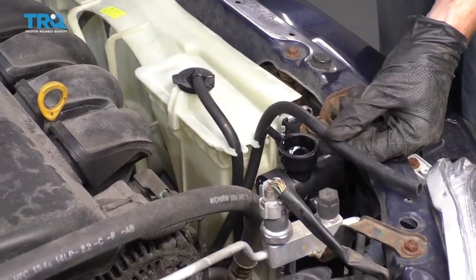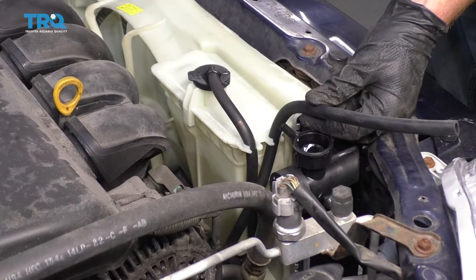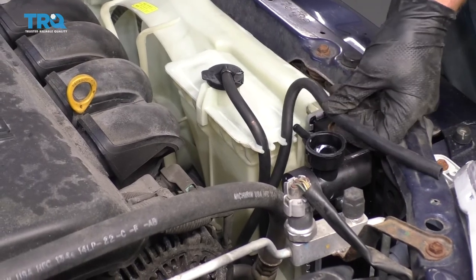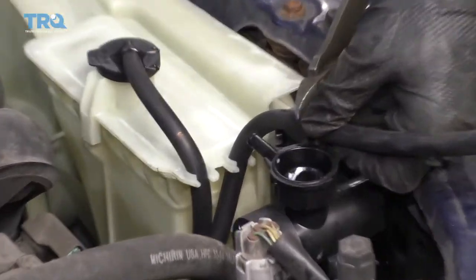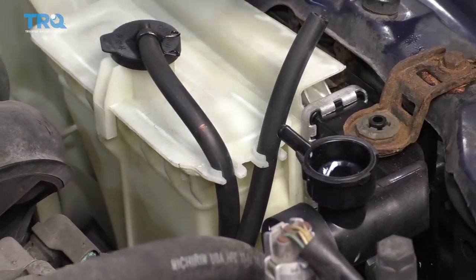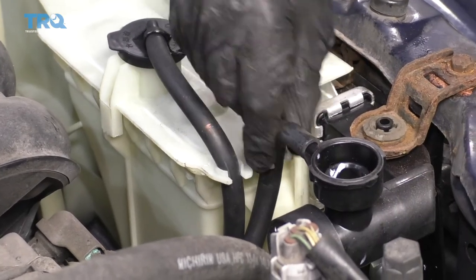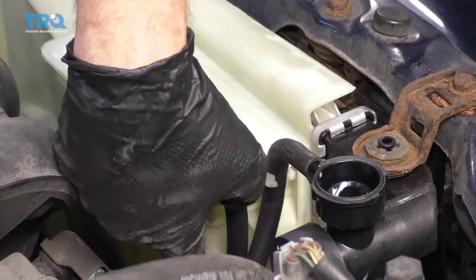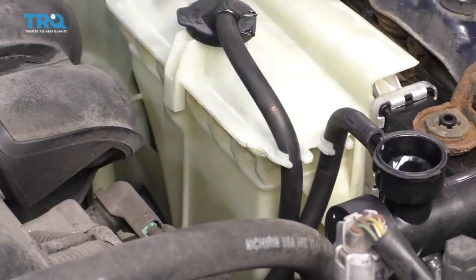Connect our overflow hose. Something that you might notice is that they made it extra long for you. It's great because it's better to be a little too long than a little too short. So just kind of estimate approximately what length you need it, trim it to the size you want, and then go ahead and slide it right onto that radiator. Make sure it's not kinked in any way — if you made it too long, there's a possibility that it could kink and then you won't have flow like you need.